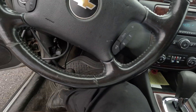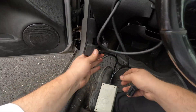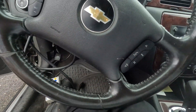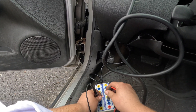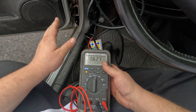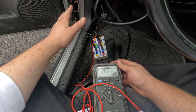Let's go back and pull up a diagram. First I want to check the network - I want to ohm out the network and see if I have 60 ohms. I'm going to plug in a breakout box and go across DLC pins 6 and 14 on the data link connector. With the key off, if everything's sleeping and all wires are intact, I should have 60 ohms - and I do. That means wire integrity is good because there are two 120-ohm resistors, one on the ECM and one on the brake control module, reading across them in parallel: 60 ohms.